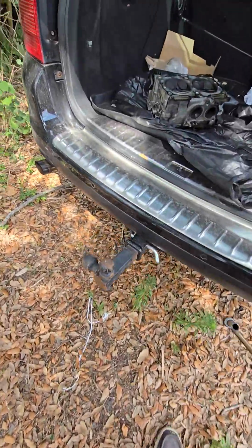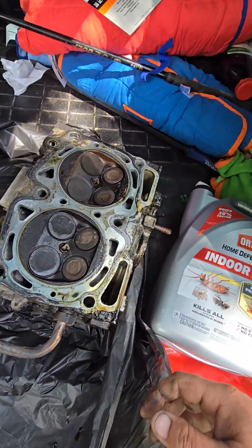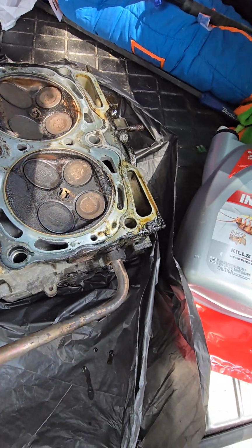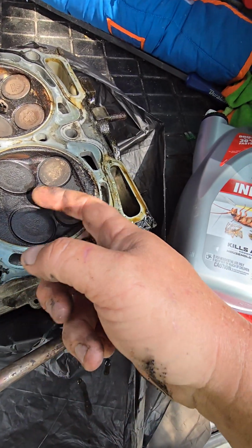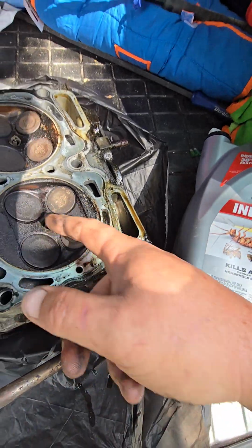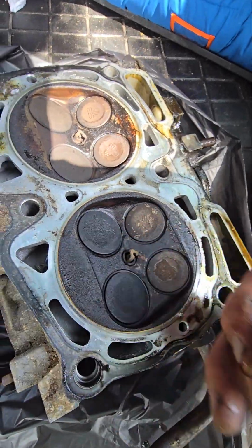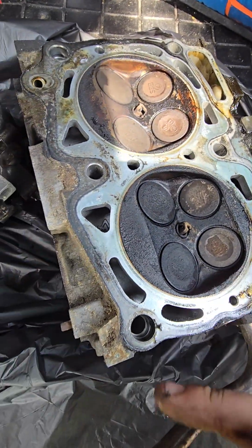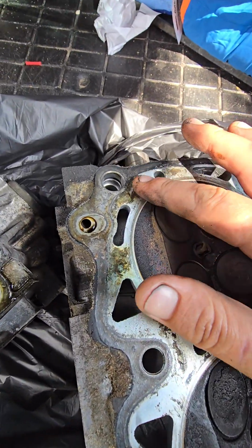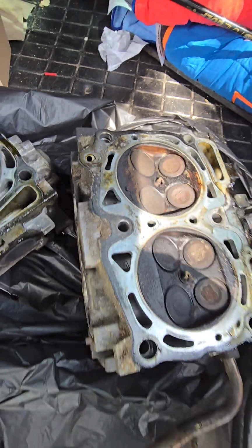This one still has the EGR rod in it, or EGR tube, flow tube. Same with the bottom side of this head. It doesn't look bad. A broken spark plug. No, that's not broken. That's the way that they're designed. These are E3 spark plugs. So, let's see, carbon buildup here. Doesn't look like there's any imperfections there either, aside from whatever this may be here.